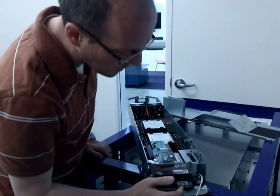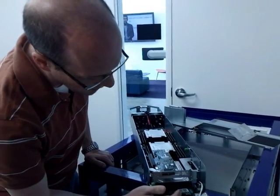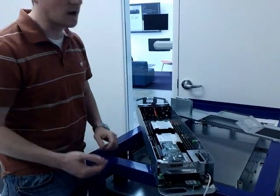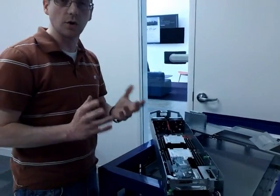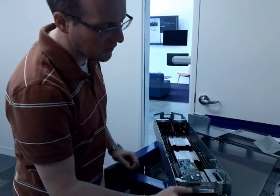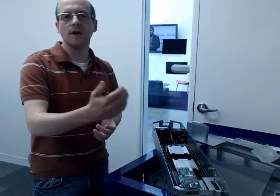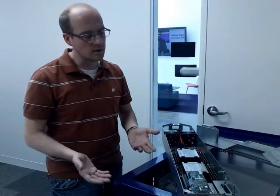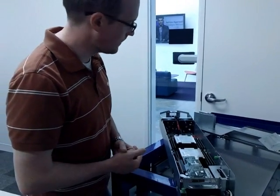We have a small 10-gigabit mezzanine card here. As we move to 10-gigabit data center designs, and since 10-gigabit is still early in the maturity of the technology, we moved the network interface card to a mezzanine. That allows us to upgrade the network interface technology a little faster early in the life cycle of the design, whereas 1-gigabit, which is much more mature, is of course down on the motherboard in most designs.